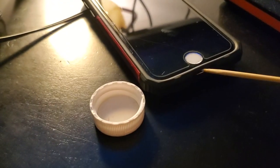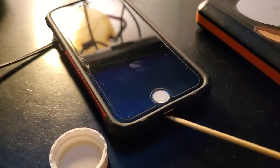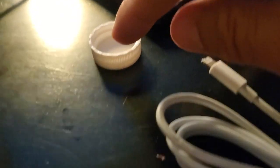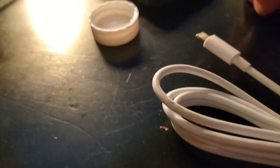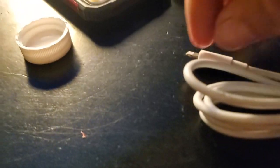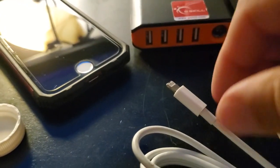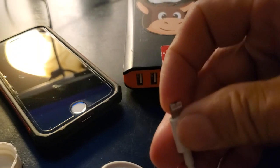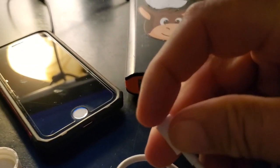Do one more for the road. You're basically cleaning off the connectors. And even on your plug — just dab your finger in the isopropyl alcohol and rub it on the connector end. Make sure the cable is unplugged — you won't get shocked, but why short out something? Just dab your finger in there, get on the old connector end and rub it in. You can also use a little lint-free rag to clean that off.